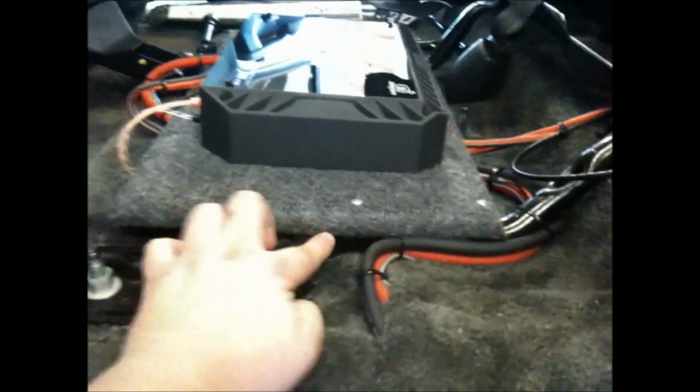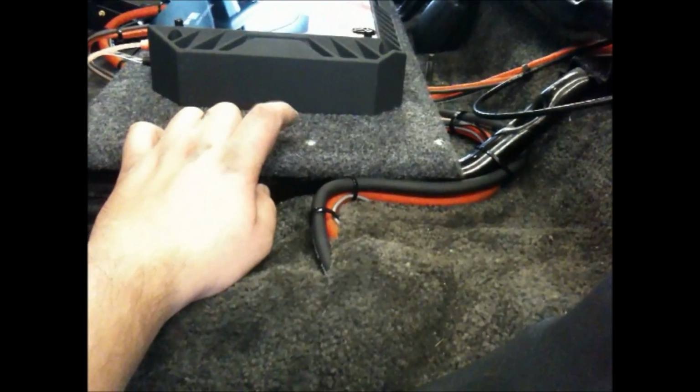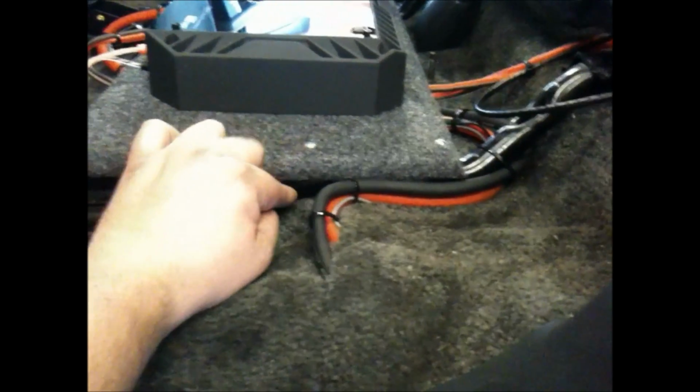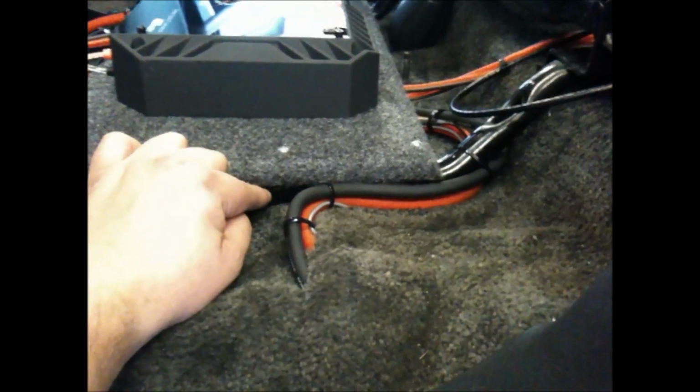I went ahead and pre-drilled and then tapped, what is this? I believe this is an 8-32 bolt thread through the hole that I drilled, and then tapped it with the threading, and then bolted to the top. Make it nice and clean. I mean, it's not going anywhere. And yeah, got it mocked up, installed, rock and roll. Looks super clean. Got a nice job on it.